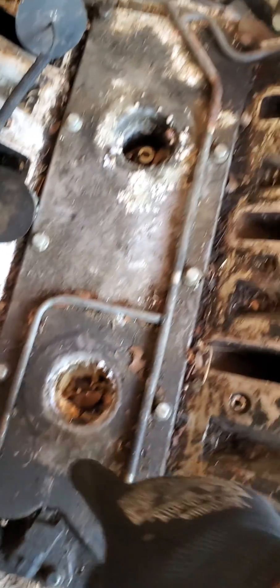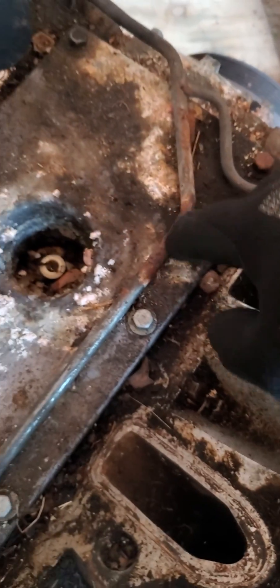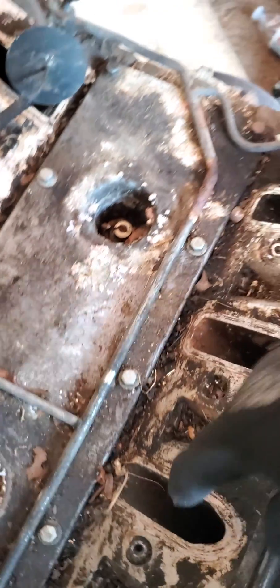This tube goes across both, bridges across right here, and if you notice right here, I got a pinhole — a rusted leak, rusted open and leaked. The coolant puddled up right here under the intake manifold and seeped into one of my intake ports for cylinder number six, I think it was, and it snapped the rod.